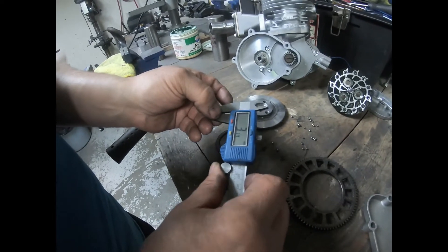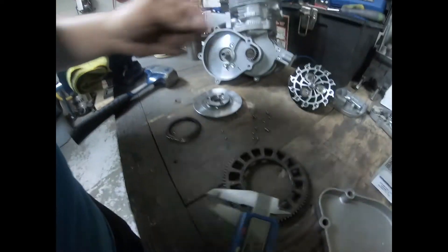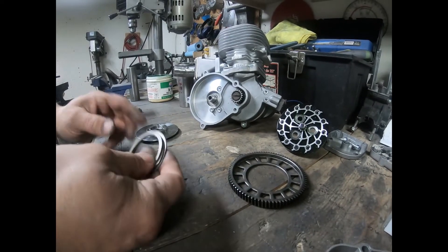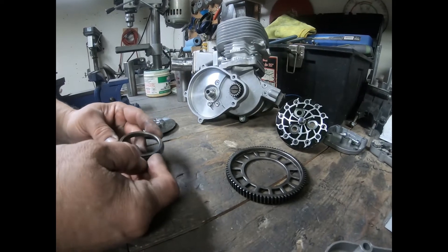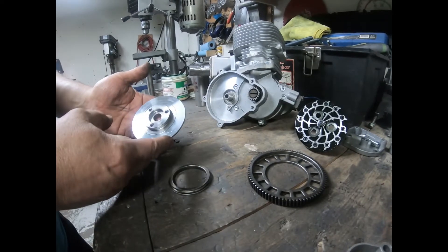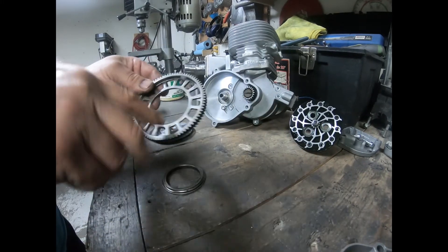Let's clean this up. I've gone ahead with a rag and cleaned up the bearing race — got all the grease out of it — cleaned up the backing disc, and cleaned off any grease contamination so I don't contaminate the pads. Also cleaned up the gear basket itself.